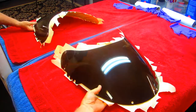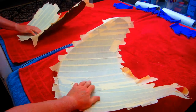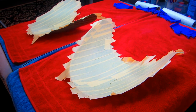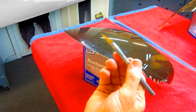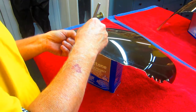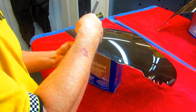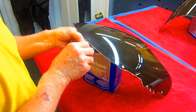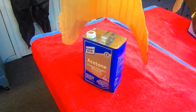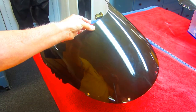The next thing is to flip this, get a brand new razor blade, trim off all the extra, and have that side hopefully protected. An old X-Acto knife with a number 11 blade is very handy for punching out the holes. We don't have to be real fancy because when we're all done we're going to put a nice edge on everything. The whole back is covered with tape and the front is ready to etch, then we'll be ready to put some carbon on this.